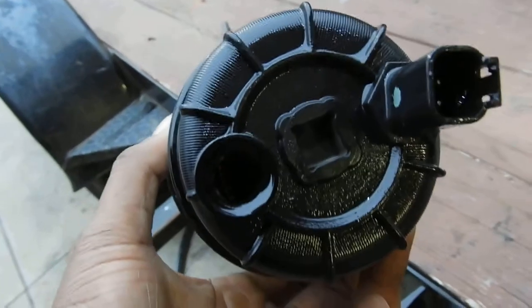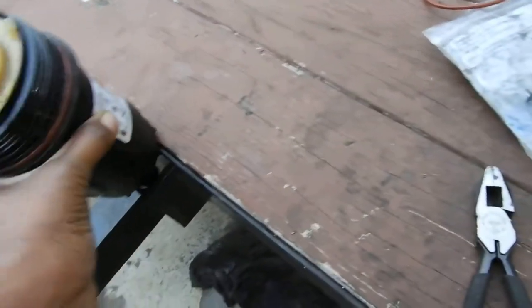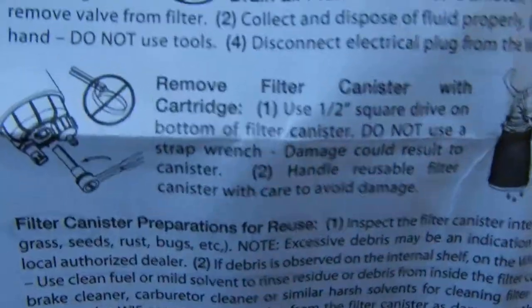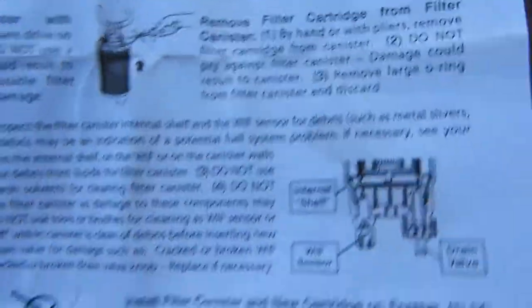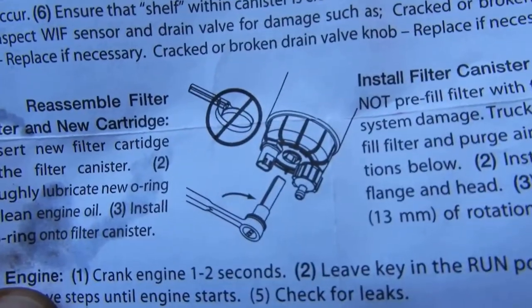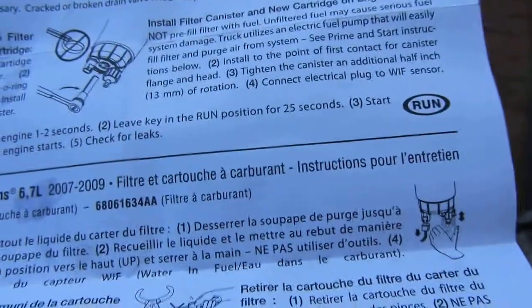Make sure you disconnect your water/fuel sensor, because if not you're probably gonna end up ripping it out. This one is a drain cock - apparently you're not supposed to completely remove that either. I'm reading all of this in the instructions. It shows using the socket not the filter wrench because that can damage the housing. It shows using pliers instead of a screwdriver to pry the filter out, and putting oil on the o-ring, then using the ratchet to tighten it back up.